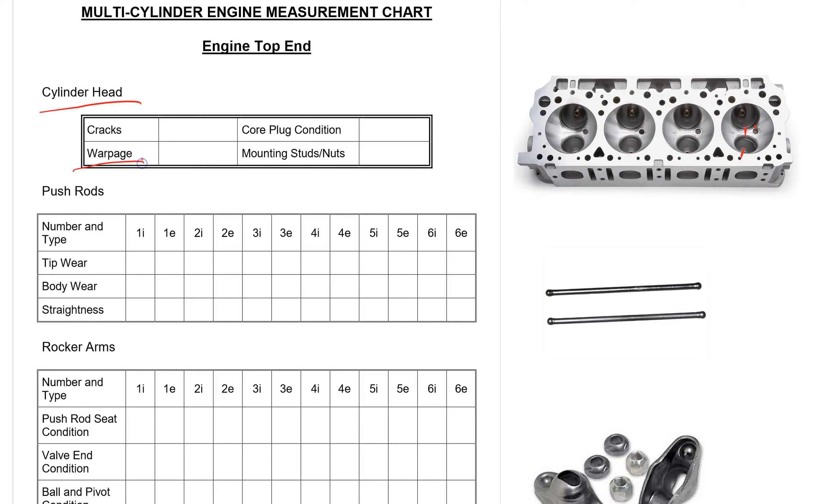When we're looking at warpage, warpage is how much the cylinder head warps. You're going to get a straight edge from Mr. Martens, then stretch it across the bottom of the cylinder head and take a feeler gauge and try to slide it underneath at different points. The thickest feeler gauge that you can slide under is the amount of warpage, and you're going to check this in several different locations.